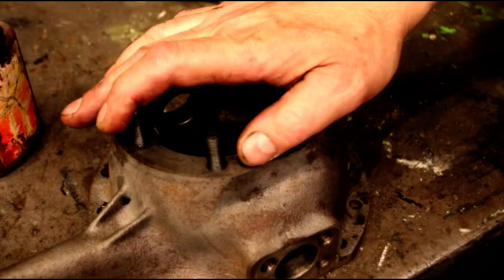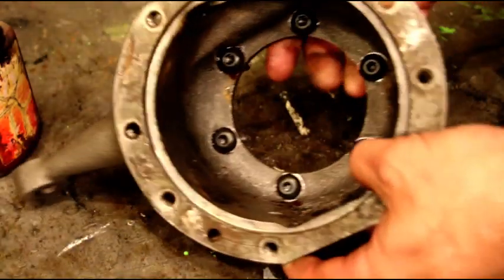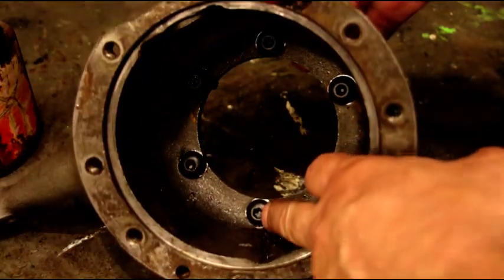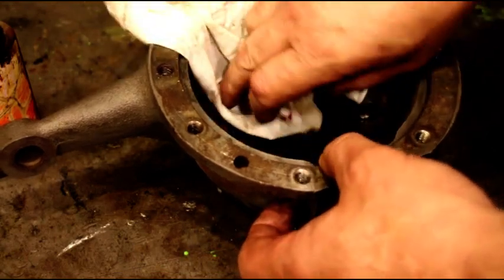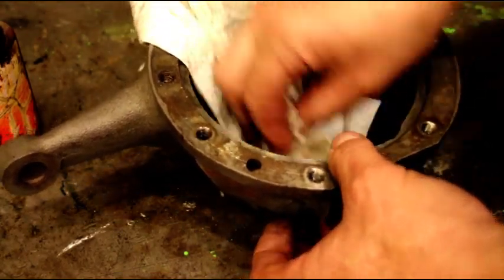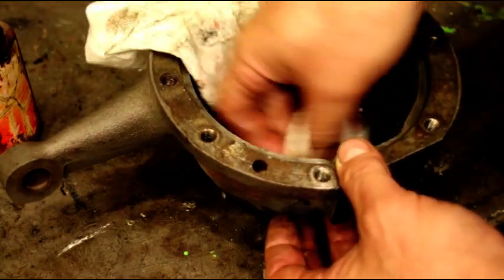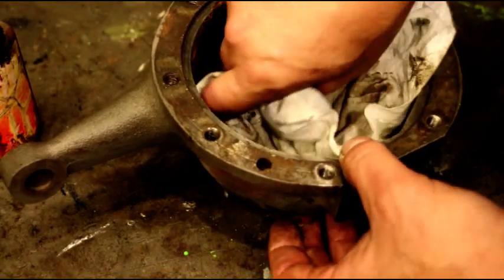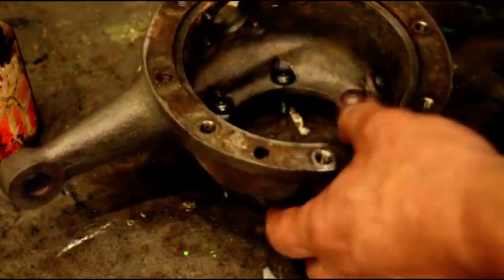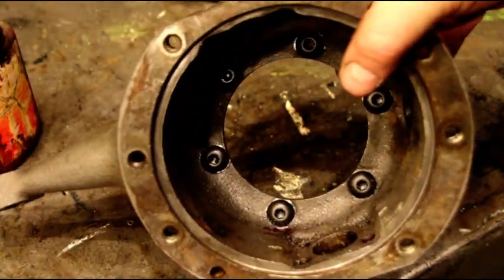I took those down to 40 foot pounds. They're seated in there perfectly on the flats that we cut. It's the lowest profile setup that I could get. You could get like half-height socket head cap screws or other button head screws, but make sure they're plenty strong — make sure they're not just a junk bolt. Now, if you were going to lose your spindle, you'd have to pull every one of those heads through that knuckle. Knuckle will be destroyed.